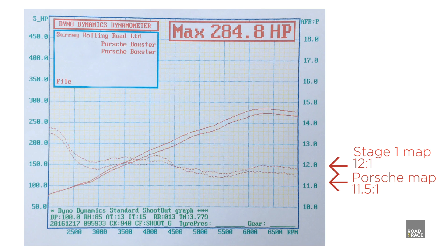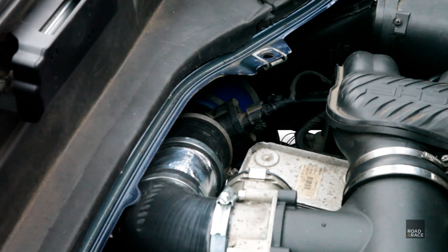It's even better when you consider that the car may have lost some power being 13 years old. Looking at the AFR the car is running even richer, which left me with one question: why? I'm not a tuning expert — all I can do is report what we've found and take some guesses. I think it's fair to say that an off-the-shelf, one-size-fits-all remap doesn't fit all. It needs to take into account every single individual mod. That's probably why when we removed the stage 1 remap and went back to the original Porsche map, we got more power.